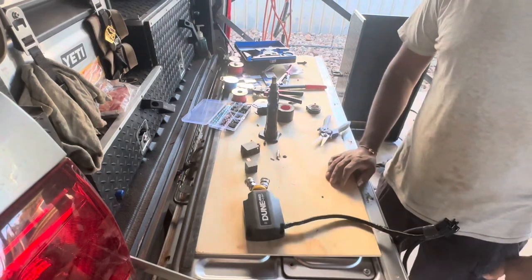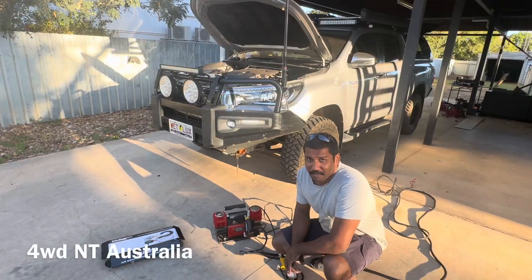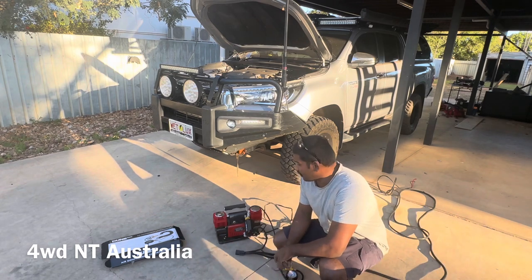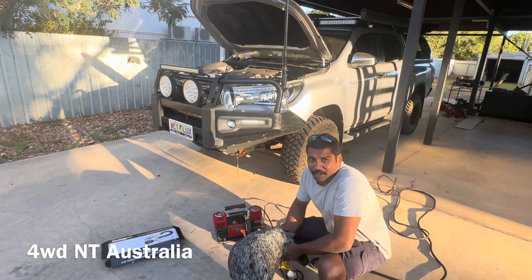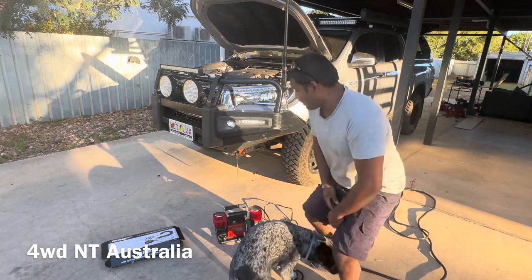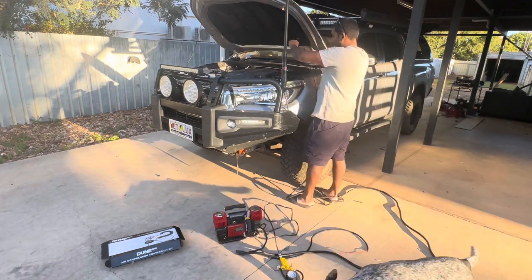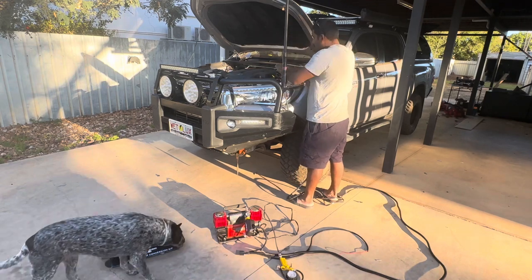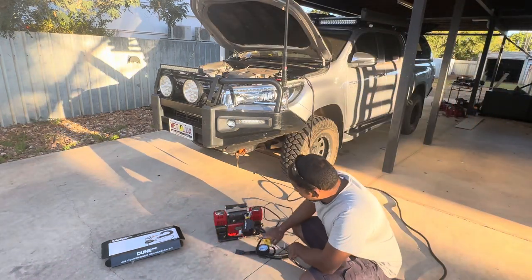This is the wiring harness I made — this is your Dune connection kit and wire coming through from the relay. The extra part I made is a proper wiring harness to work with the normal switch. You have the box, your wiring harness with the relay, the wire going to the battery with a fuse at the end, and the wire going to your rocker switch. I decided to test this before I run it to make sure all the wiring is good before installing.